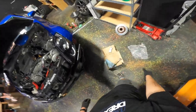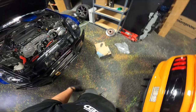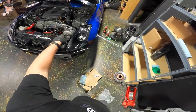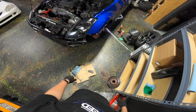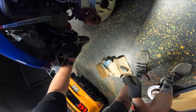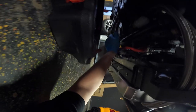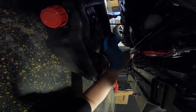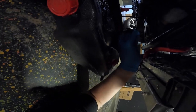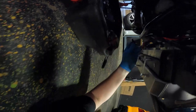Now I'm going to clean up all the leftover brake parts, put the wheels back on, and then before we drive the car again — still got to change the fluid in the pro charger, change the engine oil, and move that charge piping out of the way so the tire isn't rubbing it. We do have a magnetic drain plug, so we can go ahead and see how much metal is on the tip of it. There's like none — I mean there's a little tiny bit, but that's not abnormal.